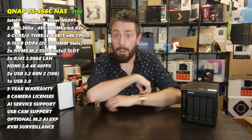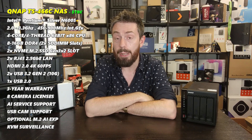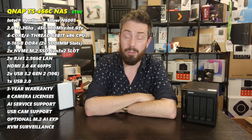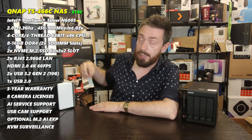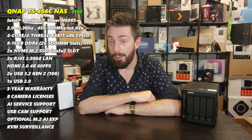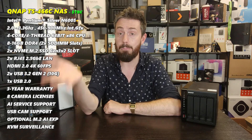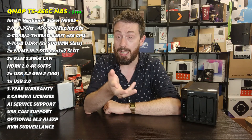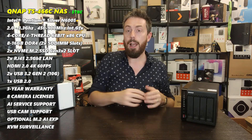If you're looking at Plex Media Server, it's definitely going to outpace the competing devices by a country mile. It has four SATA bays supporting the latest 22 TB and shortly 24 TB drives, and two M.2 slots inside at Gen 3x2 — rather than Gen 3x4, which is a shame — giving up to a potential 2,000 MB/s per second out of each M.2. On the rear there are two 2.5 GbE ports, two USB 3.2 Gen 2 10 Gbps ports, an HDMI 2.0 port for 4K at 60fps, and a USB 2.0 port.